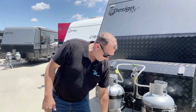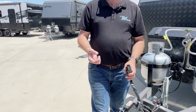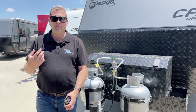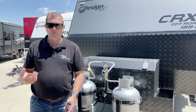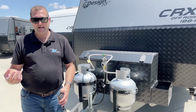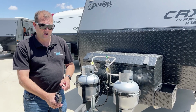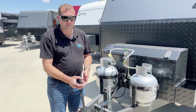We have got a standard 12-pin plug. Now with these 12-pin plugs, we'll talk more about the fridge inside, but there is a sensing wire in here for the fridge. The 7 pins are standard for any car. They are set up all the same. The bottom pins are what are going to be different. Now this will have a sensing wire in pin number, I think it's number 8 and number 12. So we'll go through that more as we get in and go through the fridge.